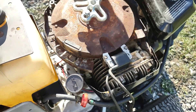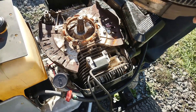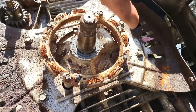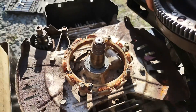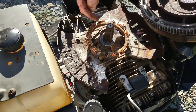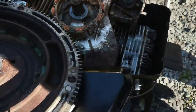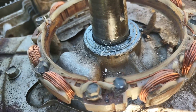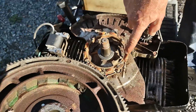Eventually you'll get it off. Once you do, grind all this down with a wire wheel brush and put Never Seize on it. You're doing this either because you broke the shear pin — you see this little notch — or your alternator, well it's actually called a stator, is bad.